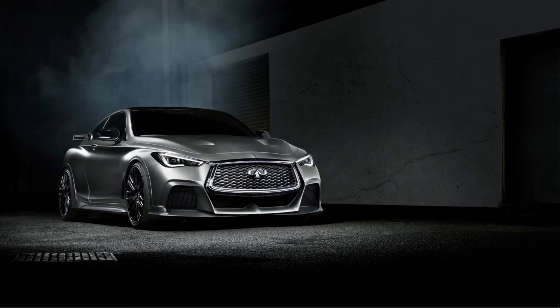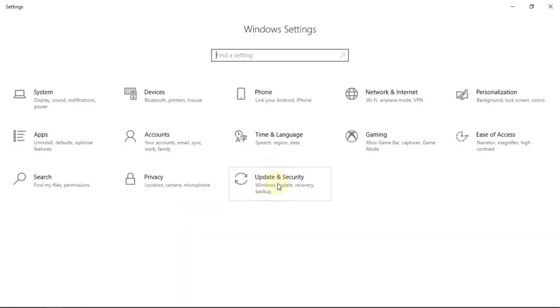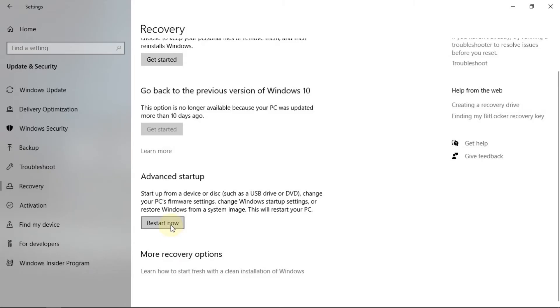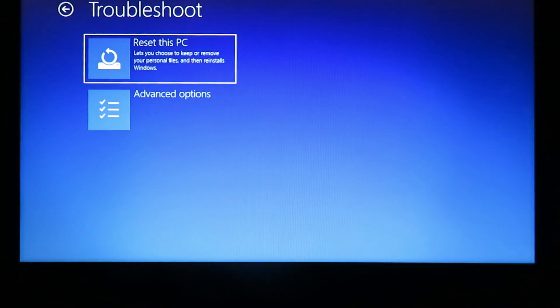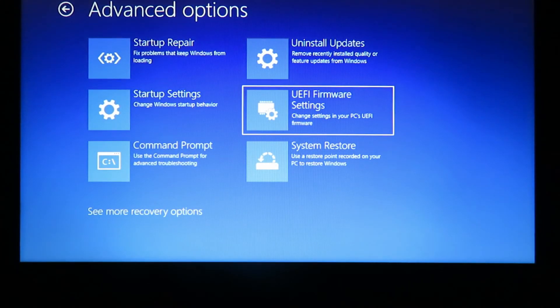To do this, you will have to enter the BIOS settings screen. You can restart the laptop and press F12 to enter the BIOS settings screen; however, different laptops can have different keys. I therefore prefer the following option: go to the start menu and click on Settings, then click on Update and Security, then go to Recovery and click on 'Restart now' under the advanced startup tab. The laptop will now restart and you will land on the options screen. Click on Troubleshoot and then Advanced Options. Now choose UEFI Firmware Settings and click on Restart.